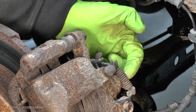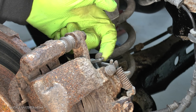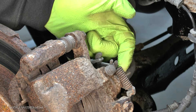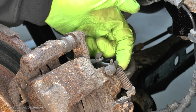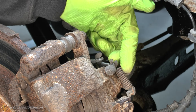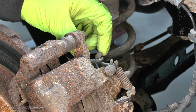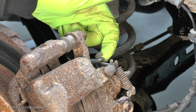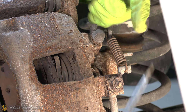This is with the parking brake not applied. By far the easiest way to detach the handbrake cable is to first remove the spring, because while the spring is there we're always fighting against it. Once the spring is out of the way, this arm will be able to move and give you the space needed to get the handbrake cable detached. So let's focus on the spring.